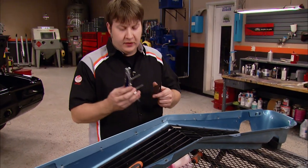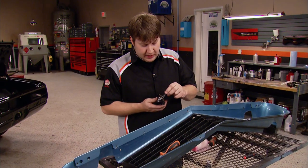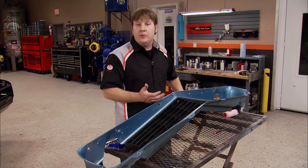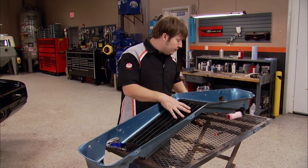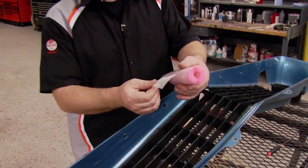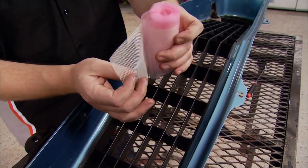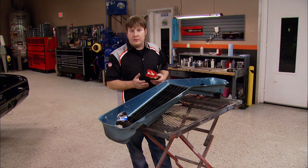Here's another little tip — if you're taking things apart, put them back together right away. That way, if it's already back together, you can't forget how it goes. To make the repair, we're going to use this two-part epoxy. If you were trying to repair a grille that was far more busted up, they actually make a webbing or netting style material that you can use for the more serious repair — it works as a structural component to make the repair a lot stronger. This particular epoxy is designed for plastic repair, which makes it suitable for what we're trying to do.